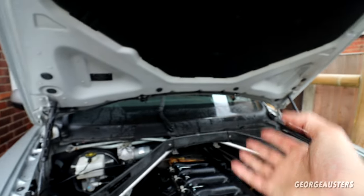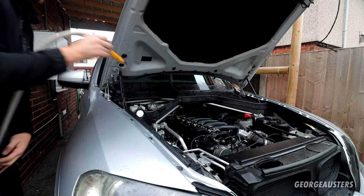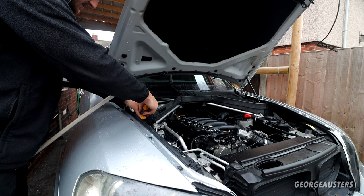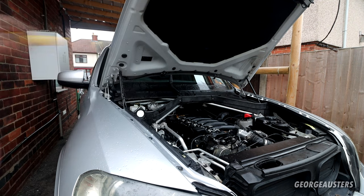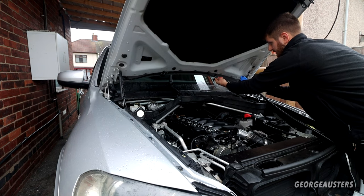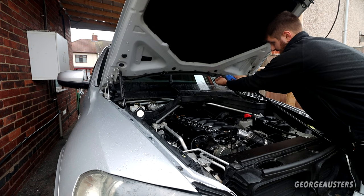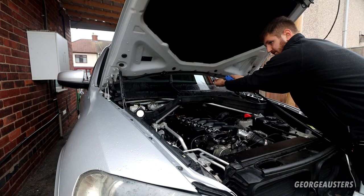Let me go ahead and show you exactly what I've done to get fluid to the washer jet, and then I'll go into what I'm attempting to do to get the fluid through the washer jets. Essentially what I've been doing is continuously filling the washer fluid reservoir with just regular water, and once that's filled, inserting compressed air on the end of the washer fluid hose and then blowing through. You'd be surprised actually how much force this creates.